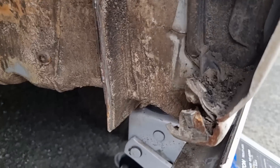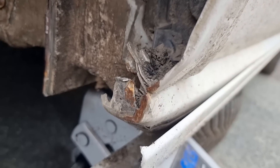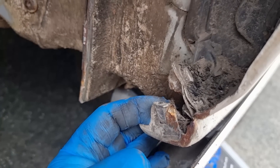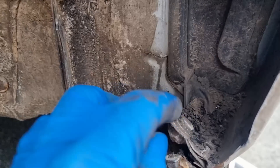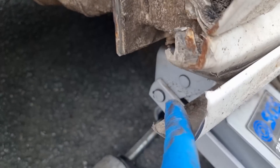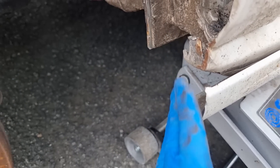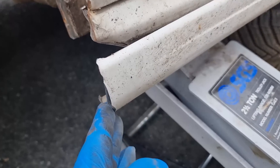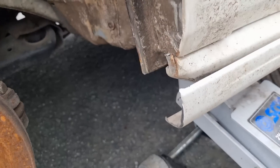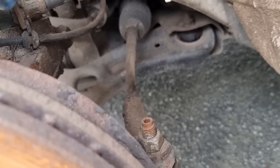There's no damage, just rub marks on the metal. The sill has been pushed up a little but it's literally thin metal so this just needs to be pulled back into shape. The actual wing bracket isn't broken — just need to tap that down. The sill skirt is damaged on the end which is a shame, so I'm going to have to look out for one of those. Yeah there's a split there so we might need a new skirt.